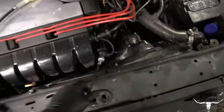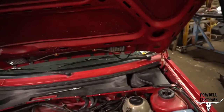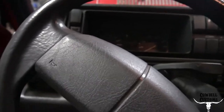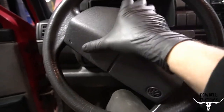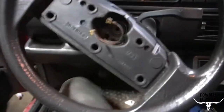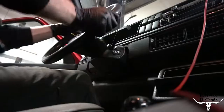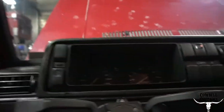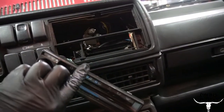I've already got that side done. I'm gonna start getting the old cable out and then get to the gauge cluster. It might be beneficial to pull the steering wheel. This style steering wheel — you just take this cover, pull it off. It's two wires; note the orientation: horn wires are black on the left, brown on the right. This has no airbag, so I won't get pumped in the face. Get that big nut off with a 24 millimeter socket and impact. Then pull these levers off the controls — make sure you don't lose them.